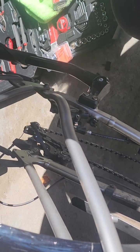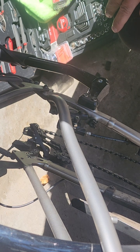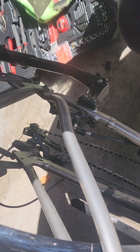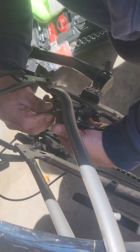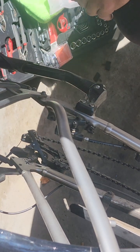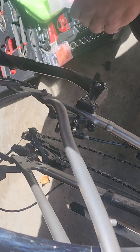That's how you bend up one side and then your brakes are in there. I don't think I need to adjust them because they're probably set wide enough apart. They did send a tool with this — it's for setting your caliper distance. You put this over the top of your caliper and slide your wheel in there, then squeeze the brake pads out to set your distance.